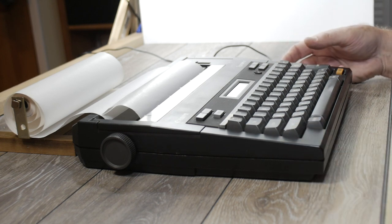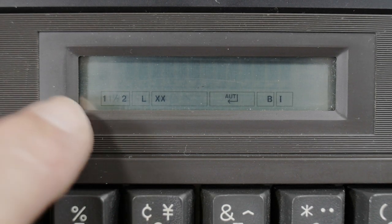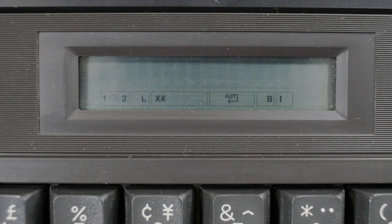The power switch is on the right side of the machine. To set up page and line spacing, I hit the Mode key to the left of the display and the first field starts to blink. You can use the left and right arrows to select one, one-and-a-half, or two-line spacing — I selected one-and-a-half. Then you hit Return and go to the next field, which is character mode or line mode — I usually go to line mode. Hit Return again, and you go to the font effect: standard, underline, bold, or bold underline. I choose the standard one.